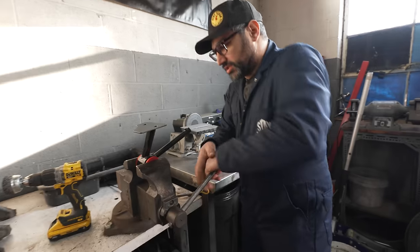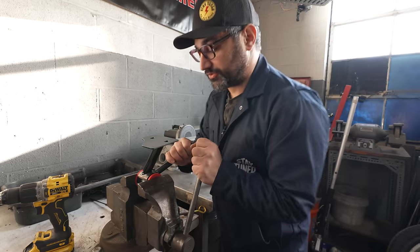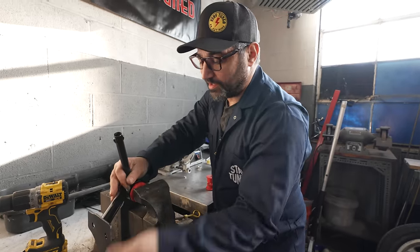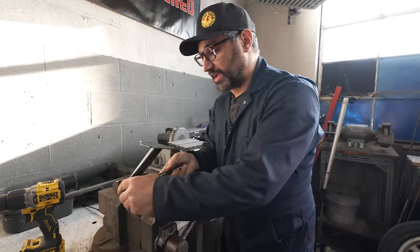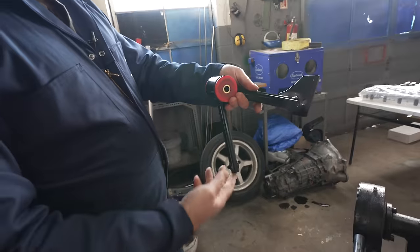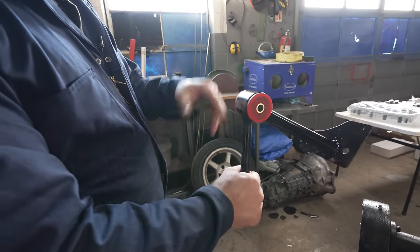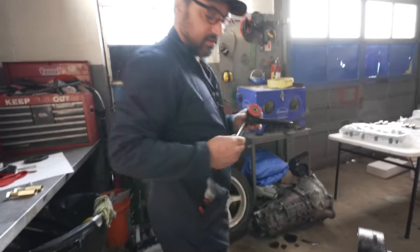And before I install these engine mounts back in the car, we're going to take advantage of some of the room that we've got on the driver's side to install a solid steering shaft from LMR and the manual brake conversion plate that's going to allow us to just mount our master cylinder right up the firewall. This comes right off the K-member. This bolts in. The forward piece actually bolts into these three as well and just has a large sheet metal piece that comes out and picks up the factory mount, so we know it should be plenty strong.